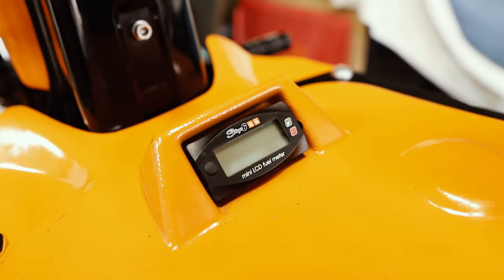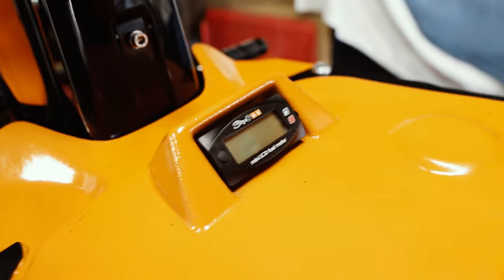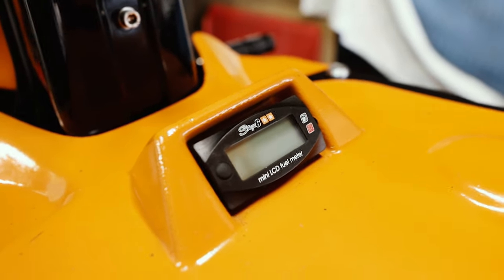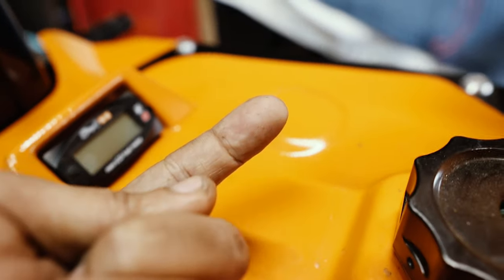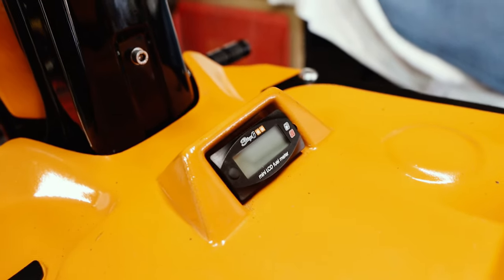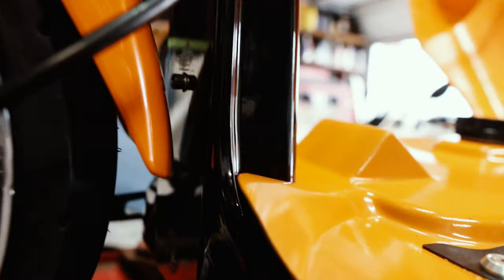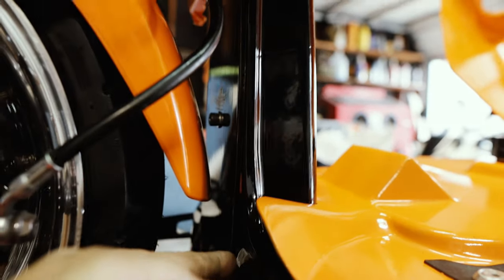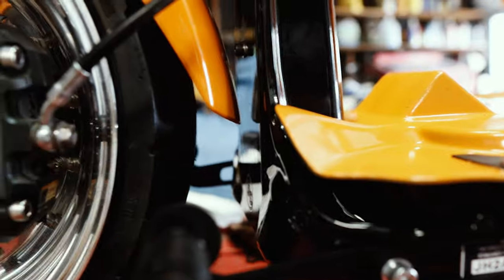Horn works — sounds like crap, but it works. I still don't have the tach portion connected to this, nor the power or speed sensor yet, but that'll come last because I'm trying to find magnets that work with this. I took the fuel gauge while the tank was empty and finally configured it — you set it to low for what is empty, and I let the float sit at the bottom. There's a little float under here that goes up and down. Then I set it to what is full: through the gas cap, I stuck a piece of wire and picked the float up as high as I could. Now it knows where full is.